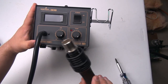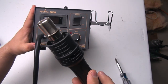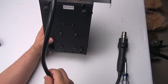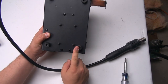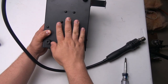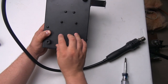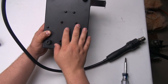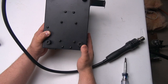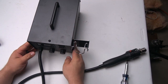So externally, we had talked about how the heating element in the wand is replaceable, and we're gonna pop the wand open and look at things inside. If we kind of look at the bottom, this thing's got padded feet, but also it looks like something on the inside is suspended on grommets, which is usually a good sign that the engineers actually took time to figure out how to make it a little less noisy. If I had to guess, the pump for the air is sitting on these grommets. So let's go ahead and pop it open.